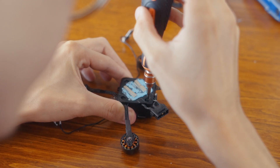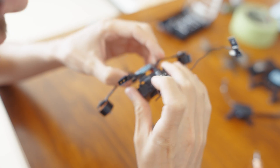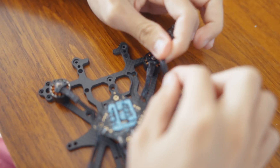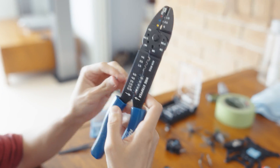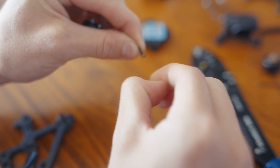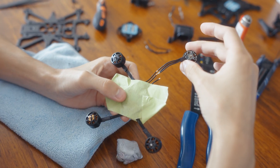So now we can take apart this and start doing some soldering. Just these two Phillips head screws here, and we've got to unplug this - just using the frame to pull it out. The technique we're going to be using today is cutting these and just soldering them directly onto the wire rather than touching the board. I'm hoping it'll be simpler but we're about to find out. My wire stripper's smallest isn't small enough so the next best thing is just using your nails to strip it. We'll put masking tape around the board so we don't get any solder on there and we're just going to work with these wires connecting those three on.